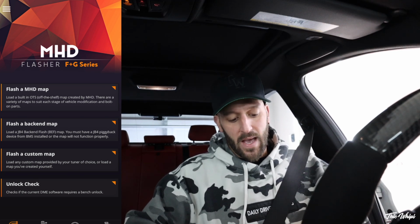You're going to see a few things in here. You're going to see flash an MHD map, and then also flash a custom map. That is something that you can do if you have some sort of custom map, but today we're just focusing on flash an MHD map. If you are not sure if your DME is tunable, you can do the unlock check, and it will tell you in there if you need to get a bench unlock or something done.